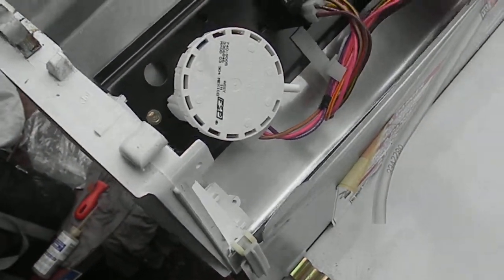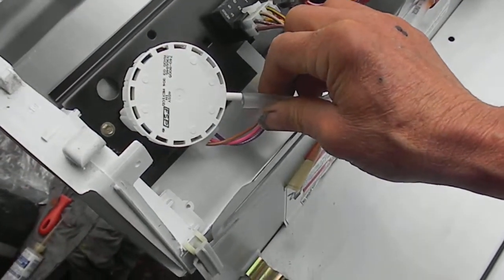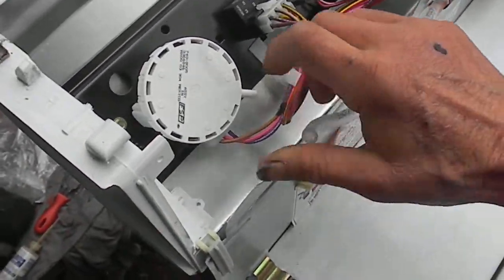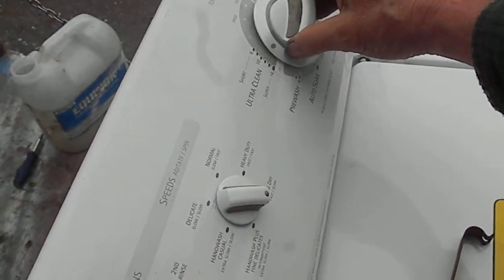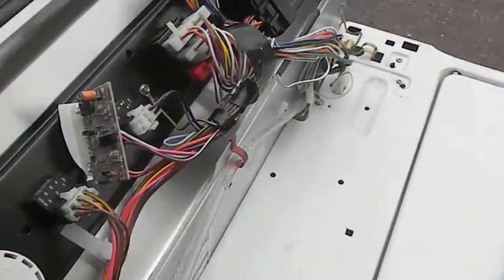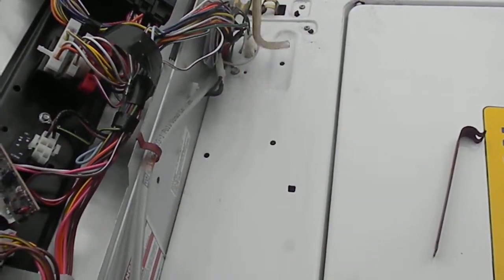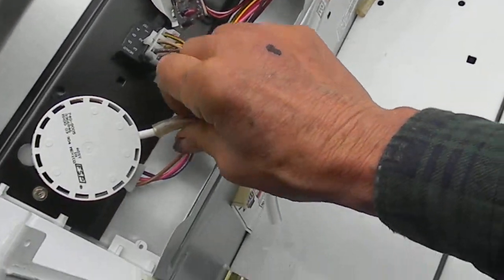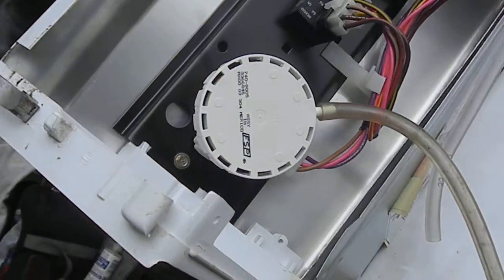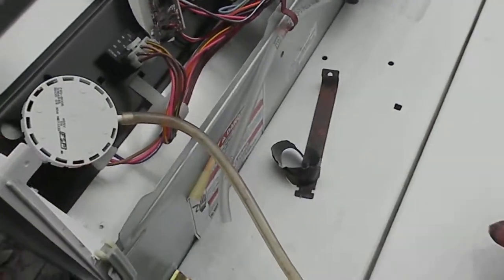What I do sometimes is just glue those — take a little bit of E6000 and glue them back on. Don't glue them too tight in case you ever have to replace the switch. But if you ever want to test your agitation, you can run a separate hose — I've got an extra piece of hose here — or you could put a straw on them. Sometimes I've used ink pens: I pull the center out, use that, hook it in there, and kind of blow on that. Then you can hear it agitate, and if you look carefully you can see it.